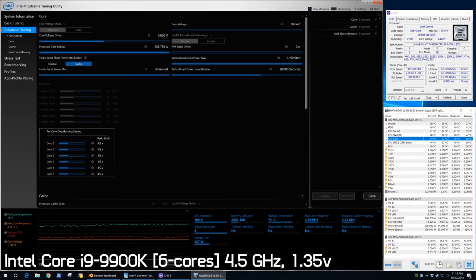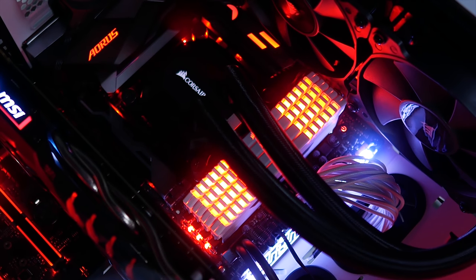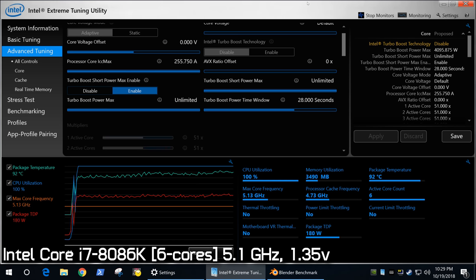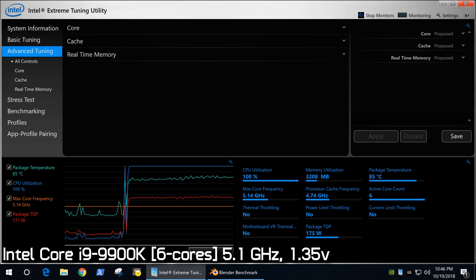We're already almost at 80 degrees, so how much hotter do things get at 5.1GHz with the same 1.35V? I opted to run my 8700K test rig at 5GHz as temperatures were much more acceptable than at 5.1GHz, and the same is true for the soldered 9900K. Running at an average of 1.38V, the 8086K hit a peak temperature of 94 degrees for both core and package, resulting in a package TDP of 188W. In comparison, the 9900K peaked at 91 degrees core and 90 degrees package at 1.366V average, resulting in a package TDP of 181W. So when overclocking, the soldered chip was just 3 degrees cooler than the 8th gen model using paste — which also explains why we saw a 98 degree operating temperature with all 8 cores active.